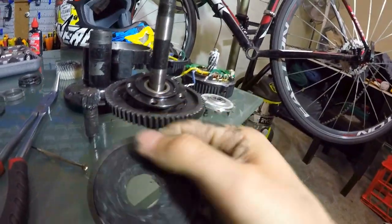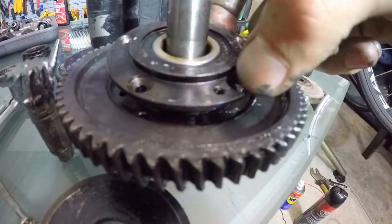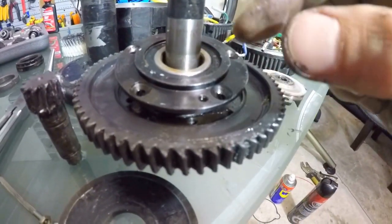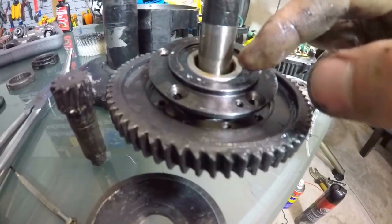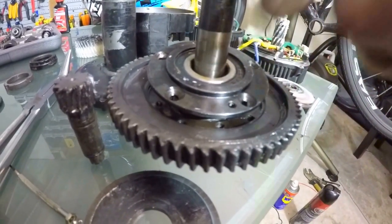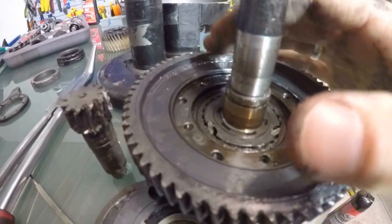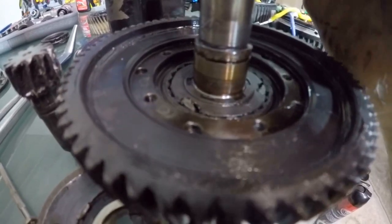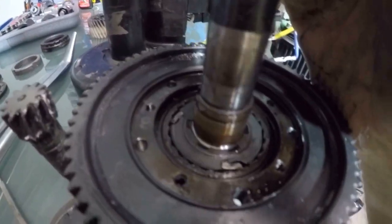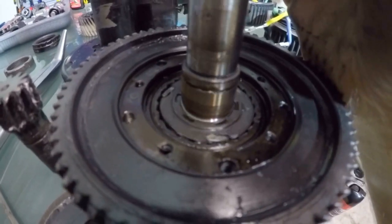I got this lid out — cool. There are five screws and two holes. It's the same system: you get one of the frame screws and put one here and one on the other side to pull it apart, because there's a big bearing that's stuck in with a lot of pressure. Once you get this out you have access to the freewheel — that's the part that separates your pedals from the motor when it's working.